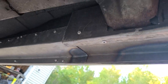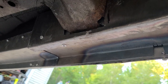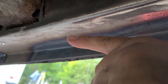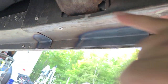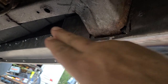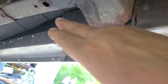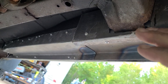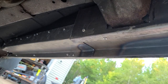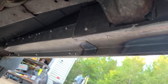As you can see up front we've got that all wrapped around. I will have to drill a few holes when I'm done and put my fluid film in there and fluid film these rails on the inside. I'm going to put some body sealer all up along the top - some seam sealer. We're going to cover all that after we weld it and then I've got some fluid film, but before I put that down I'm going to put some flex seal. I bought some black flex seal for that.